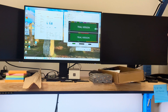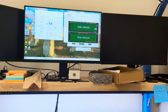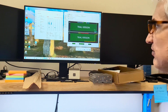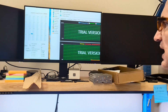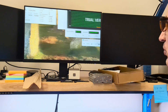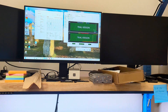You have to look at what kind of cooling you have and tailor the power delivery to it. This system is set to auto right now, which essentially means unlimited. I'm using a trial version of AIDA64 on a test machine, and we're seeing close to 256 watts draw at this moment. We're getting 5.05 gigahertz on an all-core load — you're not going to get close to 6 gigahertz loading all cores at 100%, so 5.04–5.05 is pretty good.